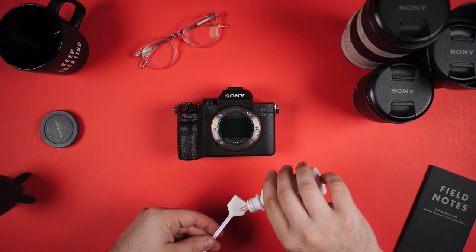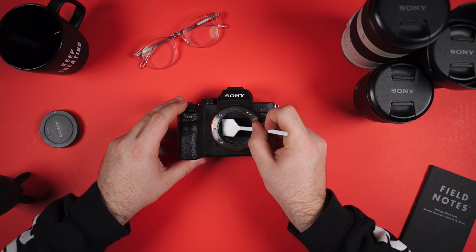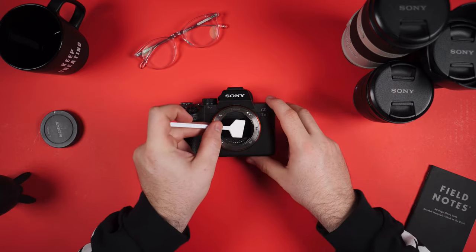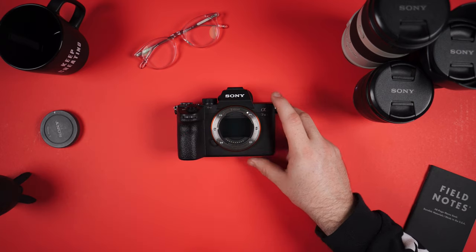All you have to do is place a few drops of the cleaning solution onto each side of the swab. Then make one smooth stroke from right to left applying slight pressure, and then with the other side of the swab, come back left to right. If you find yourself needing to do it again, please use another swab as these swabs are not meant to be used over and over — they are disposable. Otherwise you may carry over some unwanted dust particles that could potentially scratch and drag across the sensor, damaging it even more. So if you need to clean it again, throw away the original swab, grab a new one, and start fresh. Then go ahead and do a check test one more time.